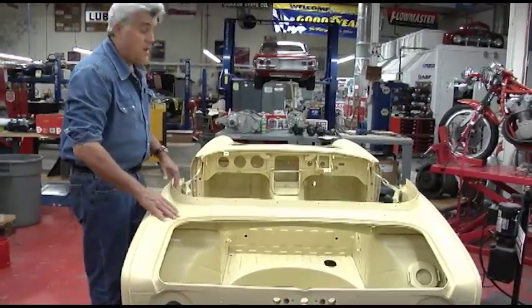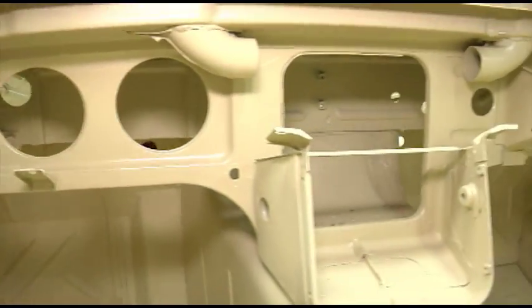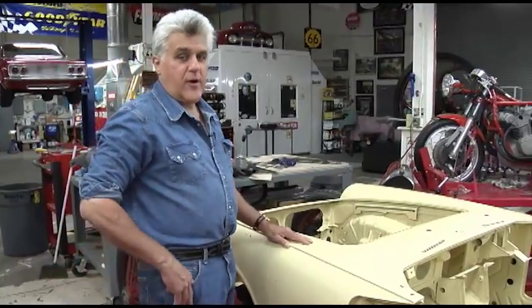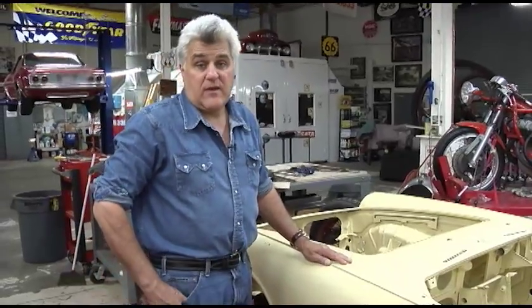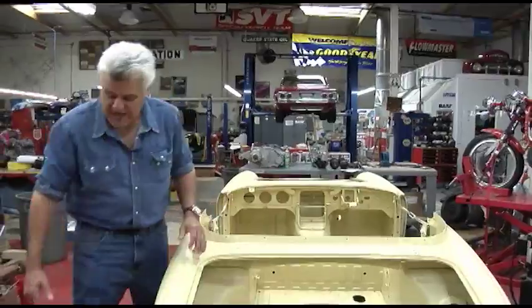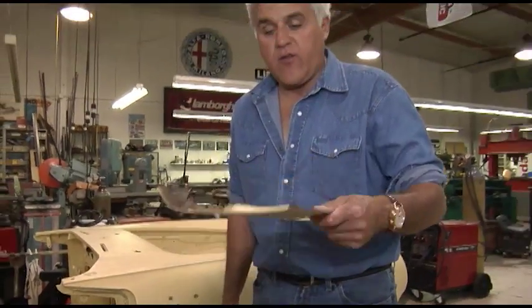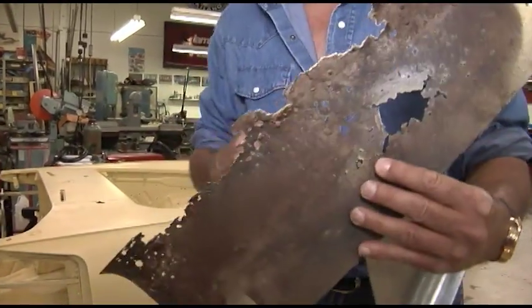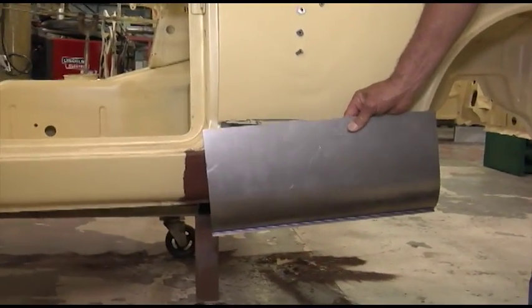This project you're looking at is a Honda S600 — a forerunner of the NSX and even the S2000. This is one of the most underrated cars of the sixties. 606 cc's, 57 horsepower, 37 foot pounds of torque. I know it doesn't sound like much, but they really were faster than the MGs and the TR3s that had twice the size — 1200, 1100, even 1500 cc. This is the chassis right here. Look how light it is. We sandblasted the chassis and had it powder coated. The Japanese make fine products, but in the mid-sixties their steel was not very good — look how thin that is. Paris cut this away rather than fill it with Bondo, and he's going to put a new piece in here using fine American made steel.